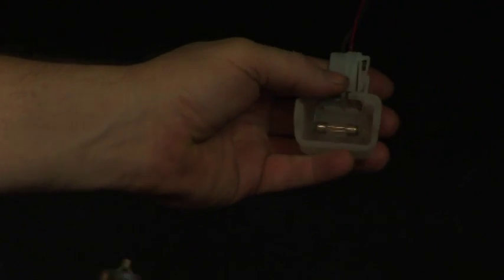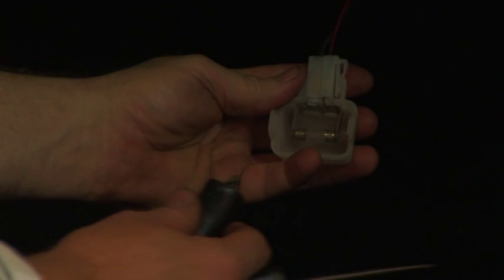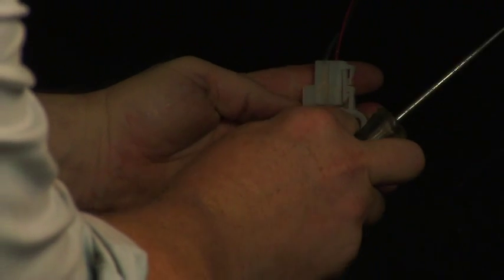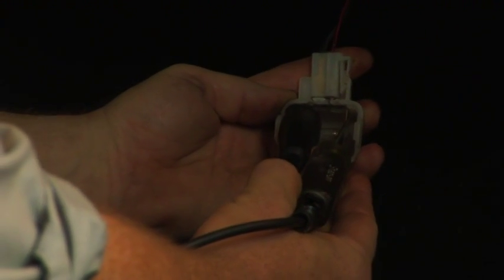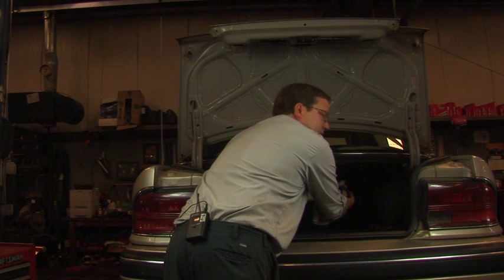In this case I can see where the wires come in, and a light circuit like this is pretty simple. We'll first take and hook up the ground lead on one side and the test light on the other, and it won't make our test light light up. So that's an indication that there's something missing.